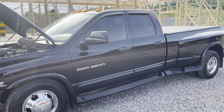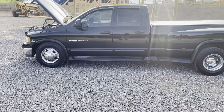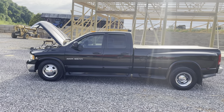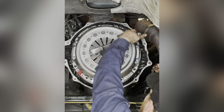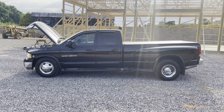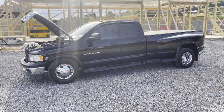This truck is also a manual transmission — six-speed. While we were in here doing all this work, the truck still had the factory clutch in it, so we upgraded to a South Bend 650-horsepower dual-disc quiet clutch. It's super quiet, good drivability, and the pedal is easy to work with.